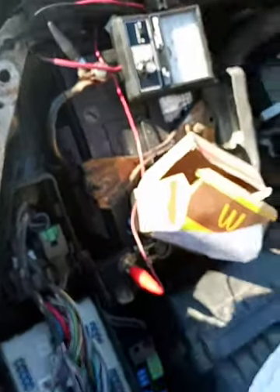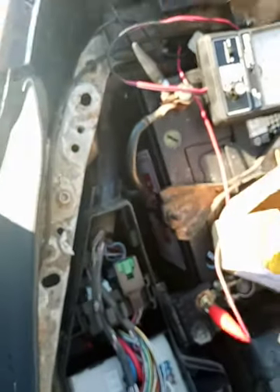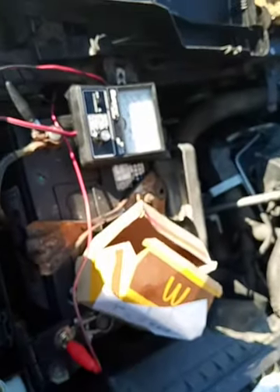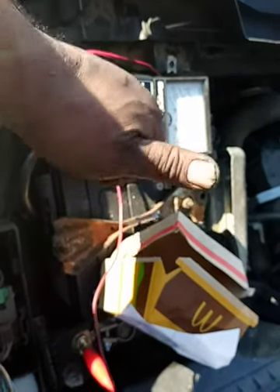Anyone else has these type of problems — audio and ignition switch? 15 volts is way overdoing it. It will kill any electronics and overload them. 14 volts would be pushing it; 13.5 is okay.